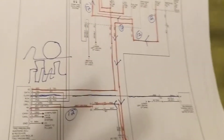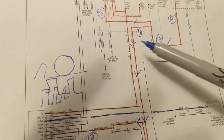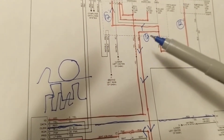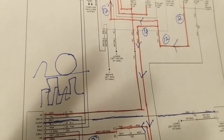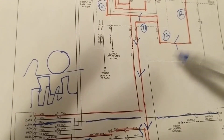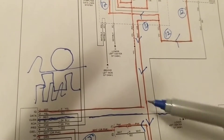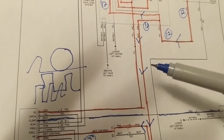I doubt that tire shops always transfer the valve properly. You will get that indicator light. Either you can live with that light, or you can put the valve in and reset it. Even if the light is on, just make sure you maintain correct tire pressure at all times. It won't shut off your engine, but it's better to know you're underinflated and do something about it.